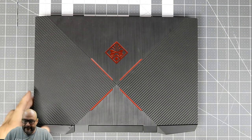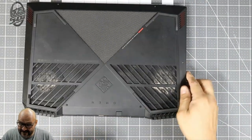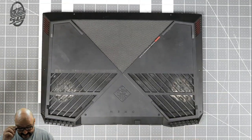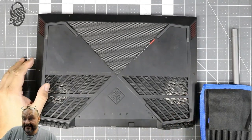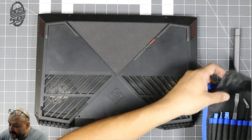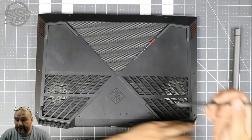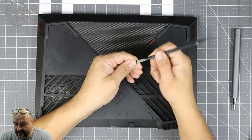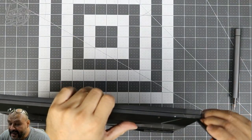If you guys remember, this thing is dirty so we're going to clean it. You can see the fans are completely locking up in there because it's overheating too. My recommendation: make sure you have something sharp — a small simple tool that won't scratch it. I got this little tool here, part of a tool kit — it has a little edge that you can just wedge in there and break it apart.